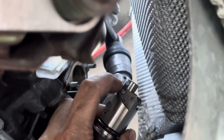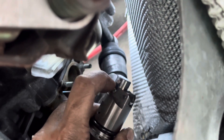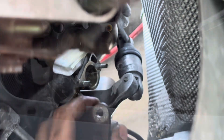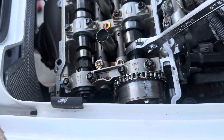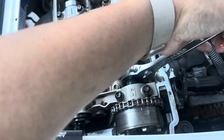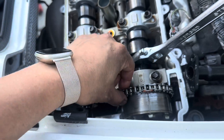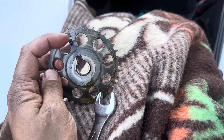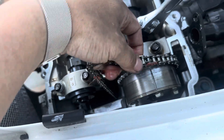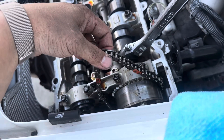You just push it down to compress it and then put this hanger in — then it'll be ready for reinstallation later. The exhaust sprocket has a 14 millimeter bolt, and you rotate it towards the left to release some of the tension on the chain to get it off. We have our marking right here with black paint along with the two dotted lines that match up to that orange paint, so now we can take this off.